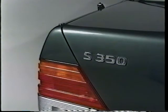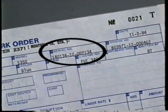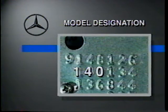The first thing that has to be done is to identify the model. The badge on the trunk identifies it as an S350, but that's a sales designation, and the Mercedes service literature doesn't use the sales designation. The service literature uses the factory model designation to organize the information. That number is the first six digits of the complete factory serial number. And since that number is entered on the repair order, it's easy to determine. If there's any need to confirm the number, you can always find the six-digit model ID on the factory-installed production plate that every Mercedes has. These three digits are the model designation, which identifies the model — or as it's commonly called within the industry, the platform — on which a series of different body types are built.